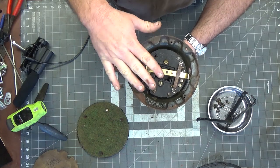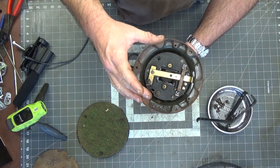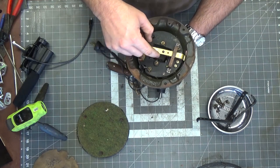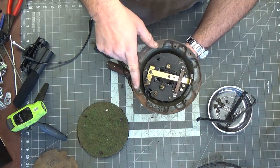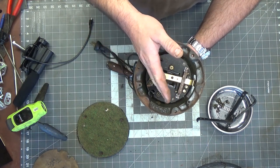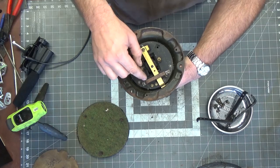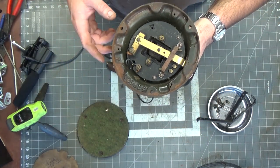There are three different pickups on that choke coil in the bottom here. Depending on where it picks up — at the beginning, middle, or end — gives you your different speeds. The beginning is full resistance, the middle is half resistance, and the end is effectively no resistance. That's the step-down transformer, if you will, that offers the three different speeds, and those connectors come through with big solid brass contactors.